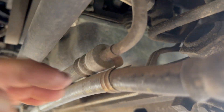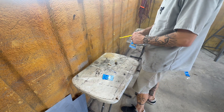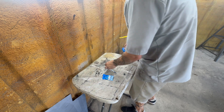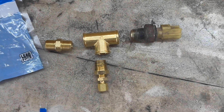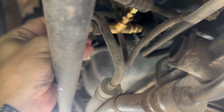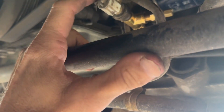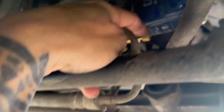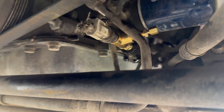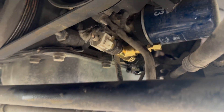So this is where we're going to tap into the oil feed for the oil sending unit. I want to keep it also, because I know some of these have a shutdown if they lose oil pressure - they'll drop cylinders and run like crap to get you home, kind of a limp mode. So I'm going to do my best to keep both sensors in the unit. A quarter by quarter hex nipple and then a quarter tee - this is the formula. You're getting into some stuff where if you throw a belt and it comes off here it could get that wire, but that won't create an oil leak. I may put a 90 on here to get this sensor in line. For now, I'm going to Teflon it and put it together.